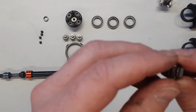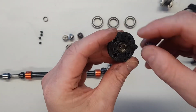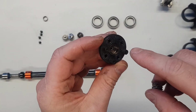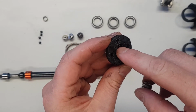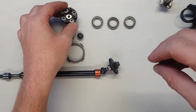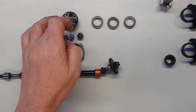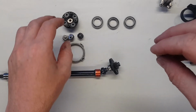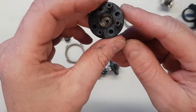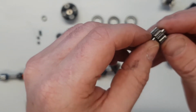Now, the planetary gears, remember this is where this bearing failed, and what I think's happened is it's due to heat. As you can see, the outer shell of that bearing actually moves about in there now. I think, if anyone knows these cars, these props get very hot. The heat, I think, is transferred into that bearing. The bearing's overheated and seized up, then basically it's failed. Now, I've got a new outer housing for it. I haven't got any other parts that I'm going to replace.